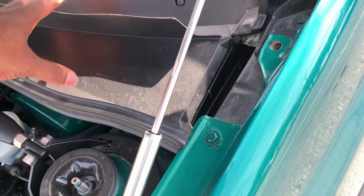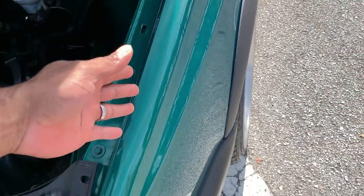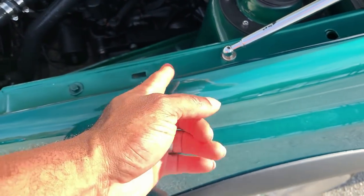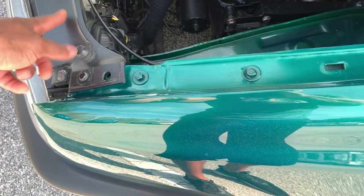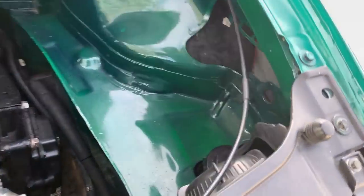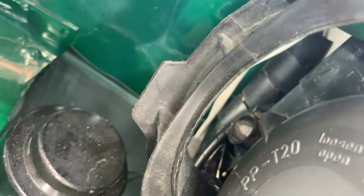All the wires that are normally connected up here are still connected up here. And then pretty much I brought all the wiring down. I think the majority of the lengthening is from here, about halfway to about here. So it's probably a good 18 inches, I think I extended each wire. I don't know if you could see it, this is some of the wiring, that's headlight wiring. You can see there's a loom right there. That's where the wire is coming down. That's in the front of the fender, but down towards the bottom of the frame rail.